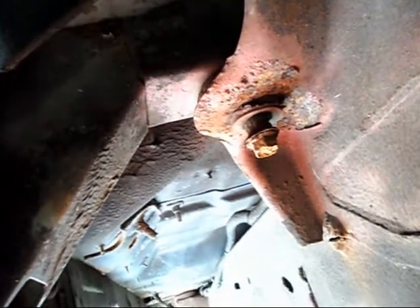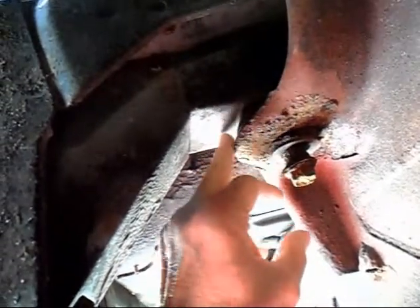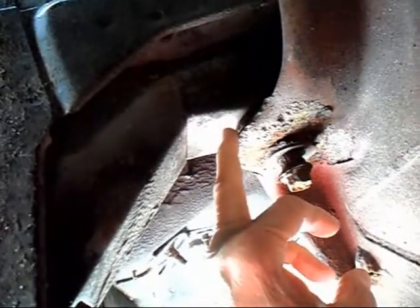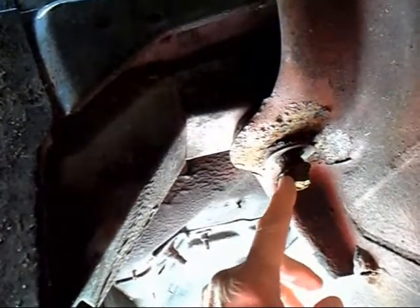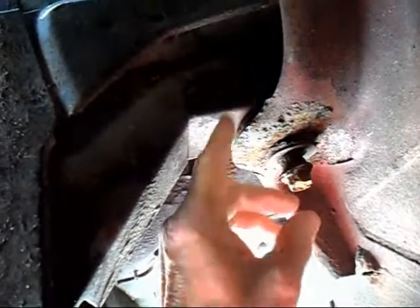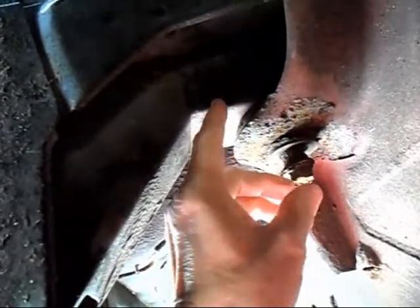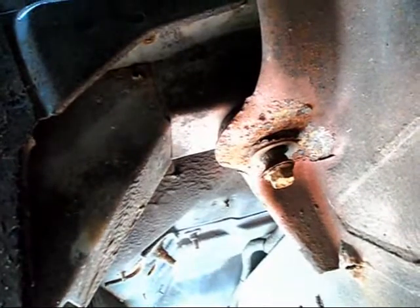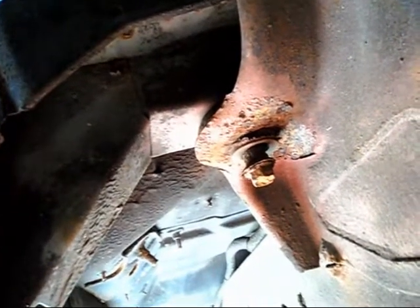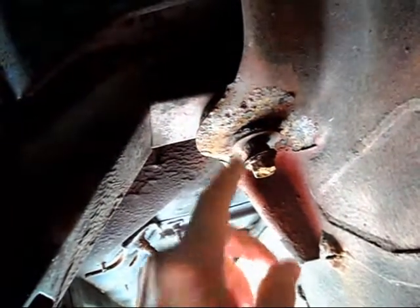It looks like a job that I don't think I can do, mainly because the nut is captive in here. There is no actual accessible nut — from what I understand, based on diagrams, it appears to be one of those nuts that just lay in a clip way up inside this channel, which you cannot get at. If you put a wrench on this and try to break it free, most likely the whole thing will just spin around in there and you'll never get this out. And even if you can cut this off, you wouldn't be able to get it out or put anything new in here. This old goat normally don't tackle a job like this — unlike body work, this is a job for a pro.